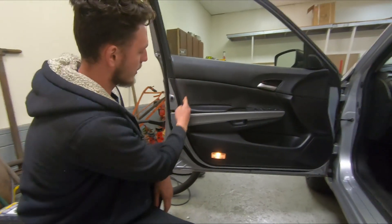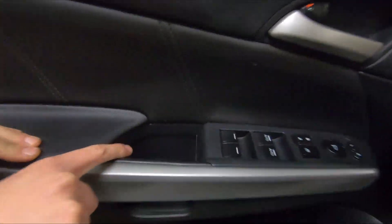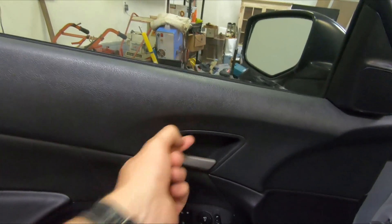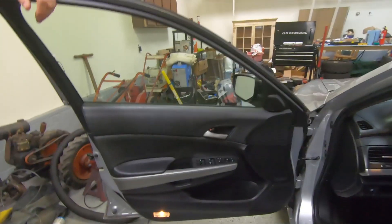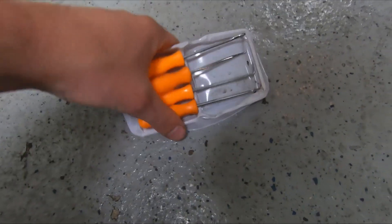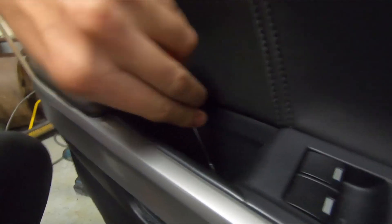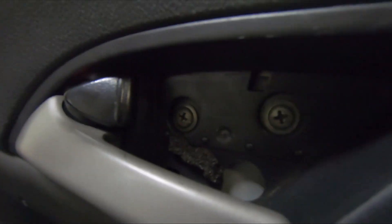We're doing this on an Accord, but you can repeat this on all kinds of cars — Honda, Toyota, even German cars. All cars usually have the same kind of installation for door panels. Usually it runs along with clips on the side, and then there are a few screws or bolts hidden behind little panels. For the Accord, pop this panel off — there are two Phillips heads behind it — and the door panel pops off. You can disconnect the handles and disconnect the wires to the buttons. So we're going to get the door panel removed. You can also use Harbor Freight two-dollar packs of picks to make removing those little panels much easier without causing damage.